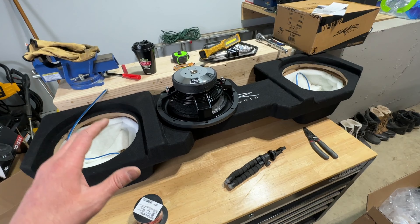The first thing I'm going to do is get the old speaker setup out of the truck and do a test fit of the new box, because sometimes these wood boxes with carpet on them are a little thicker and may require spacers under your back seat. Option one is putting spacers under the back seat brackets to lift the seat up. Option two is what I'm going to try first — cutting the carpet out from inside the wells where the speakers sit, to give a little extra depth.